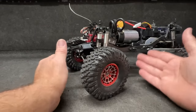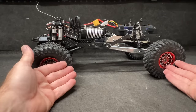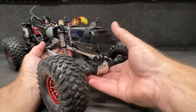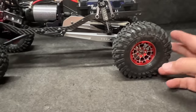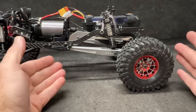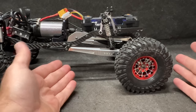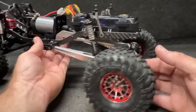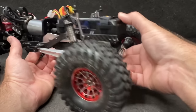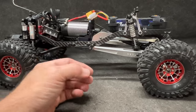I want this to be as light as I can get it so it operates fine and quick. You'll notice on all your high-performance race trucks they're almost never a solid axle, because if you have a lot of unsprung mass — like a solid axle — when you hit a bump all that axle coming up bottoms out and transfers into the chassis. Most race vehicles use independent suspension because less unsprung mass allows for a faster-reacting suspension.